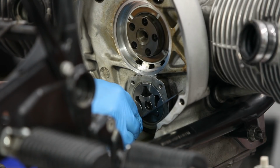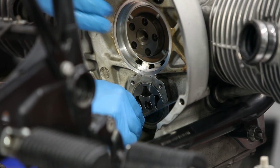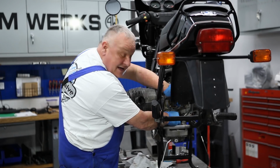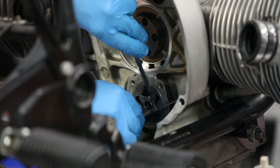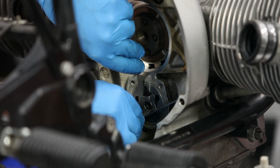I can't see that well anyway. So just move it at about 5 degrees, 10 degrees, so that there's a little bit of an angle. Then the gauge fits in, so you know you're in the right place, but it won't go through. Because you're basically putting that straight edge up on edge on the flat surface, and it won't go through, so dynamite.